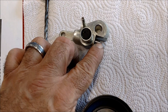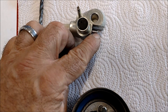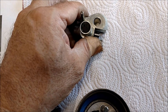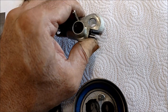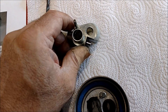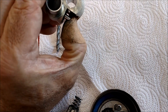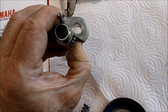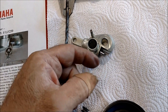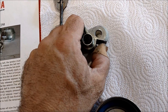Here's the tensioner. What I did is I loaded it up in a vise very gently, just to get a better understanding of how it works. When you first take it off after it's been sitting, it's going to be rock solid — like you can't push it. After you compress it ever so slowly and let the fluid exchange back into its reservoir, it'll begin to let you compress. It's actually coming back out and getting stiffer and stiffer, and eventually all the fluid will have returned back into the chamber behind the pin and it'll be rock solid.